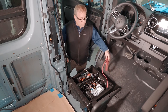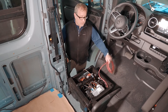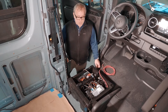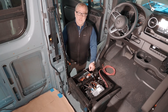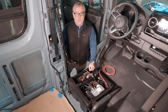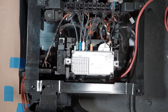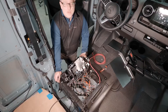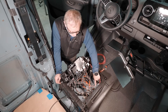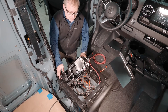We've also got additional wiring coming from our aux battery system under the hood that we're connected to here. You can connect to whatever your power source is. We also need to remove one of these components — we're going to use a 10 millimeter socket to do that — and that'll give us access to the factory ground location that we can use to connect our power sources to. We've attached the ground wire here to this factory ground location and run it out at the back of the pedestal. We'll now reinstall this plastic component and move on from there.